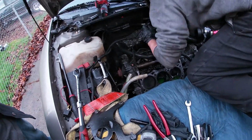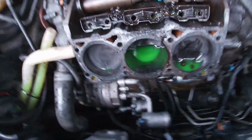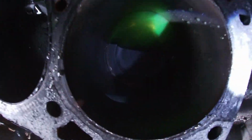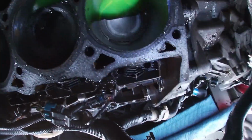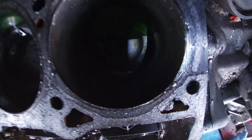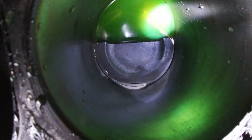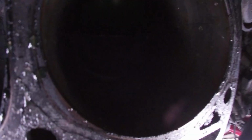Oh, yeah, that piston not happy. Oh, shit. You saw it in there? Yeah. Look at your phone. You see it? Not really. Some of the parts of the piston literally broke off. It's not zoomed in, so... I see it. Oh yeah, that's literally part of the piston broke off. I think that's an exposed ring. Right there, the ring land just melted, or the top of the piston. Like melted it. Let's get the coolant out of there and get a better look at it.